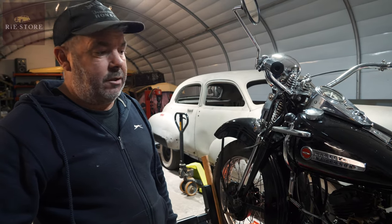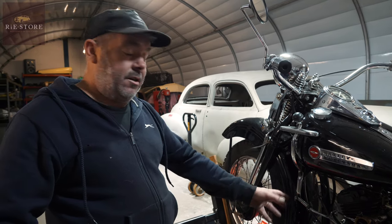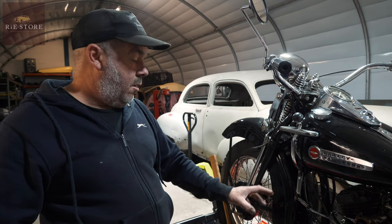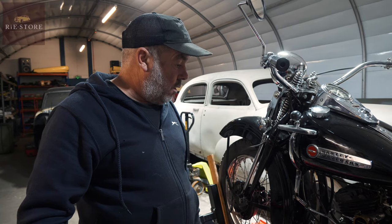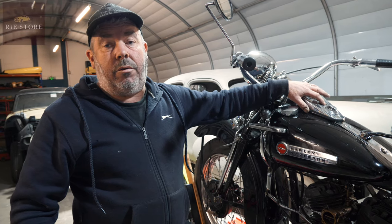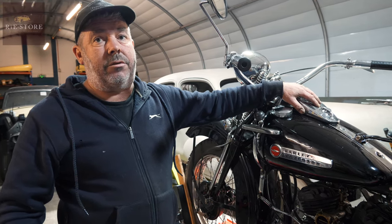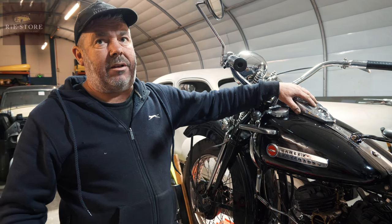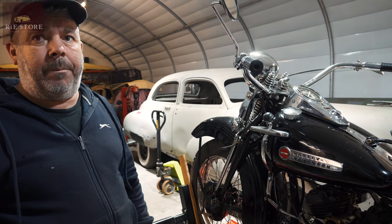If you're going to ride one all the time, you need to get it right. Things that sit in somebody's garage — they fire it up once in a blue moon and leave it on a trickle charge — they'll be fine. It's just a matter of getting that dynamo set up right. I haven't really done a lot of them, so it's something I'll have to study up on. But if it's charging, as soon as you fire it up the light goes out, which is normal. I've never, ever heard of one where the light coming back on tells you it's charging. I don't believe that's right.